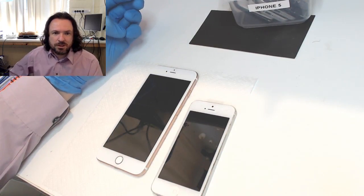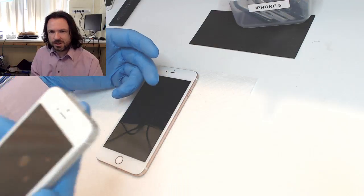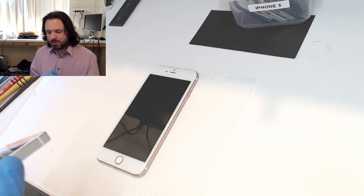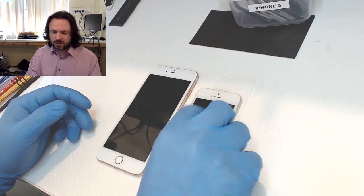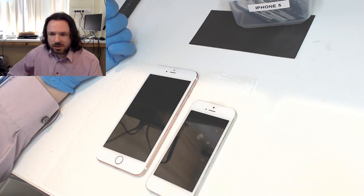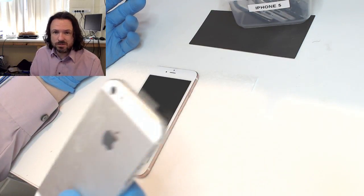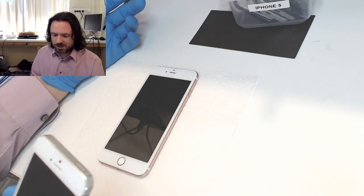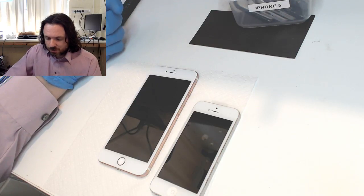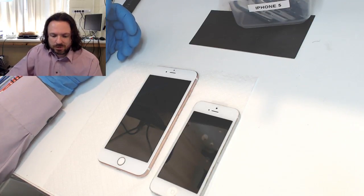Most OEM 5G screens have pink hues. When they come back a few times after they've been refurbed, they start developing a pink overall hue, but you also get a bit of perimeter encroachment of excess pink, or is it from the inside? I've always been told that it's from the refurbishing process, the heating and the cycling or whatever. So maybe it's not, but I never saw original OEM screens, new ones, with that. It just seems to be something that gets worse over time. So maybe I'm wrong, but as far as I understood it, it was the reworking process that tends to make the display slowly over time develop that color hue.